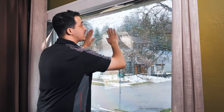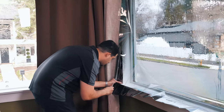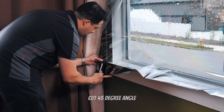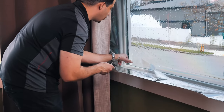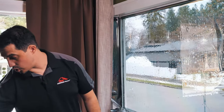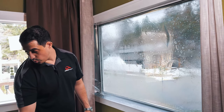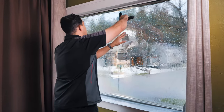Now we're going to take all these bubbles and get them moved out of the way — all the big ones. One of the most important steps: notice all this excess. I'm going to go to the corner and cut a small hole at the frame of the window itself, cutting at a 45-degree angle. By doing that, it allows me to push this film in without creasing it, just like so. Now I've got my film really well tacked — it's all set and it's not going to move anywhere. Now I'm going to spray this side of the film with the liner removed and get it fully tacked with my installation squeegee. First squeegee — you should come down and then to the side.